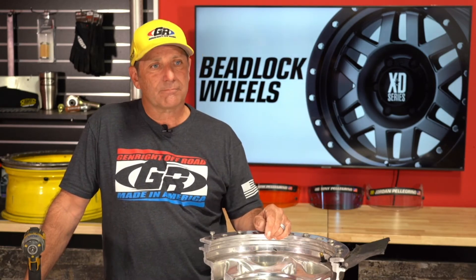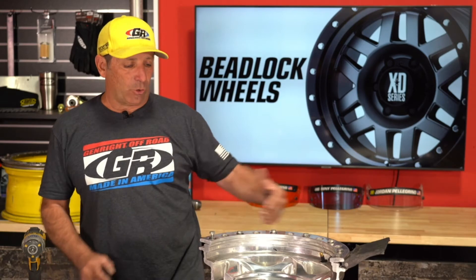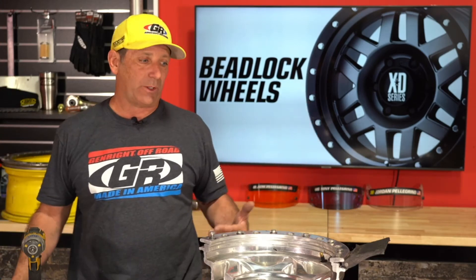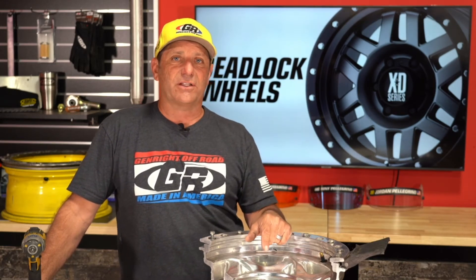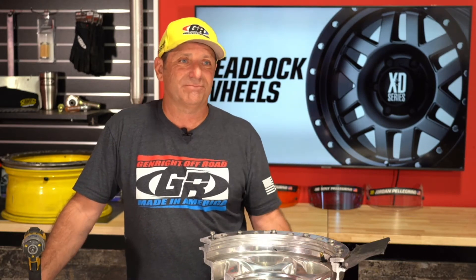Justin Andrew asked about tire balancing beads versus typical wheel weights. I like the beads better. The wheel weights are way inside and you have to put a lot of them on to affect the large diameters we run. The balance beads typically do a pretty good job — we run them on our RV even. When you go to take it apart it's kind of a mess to clean up, but it works.